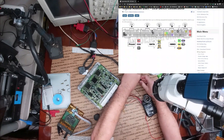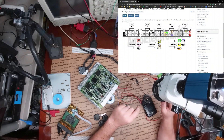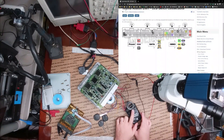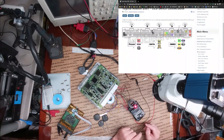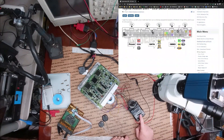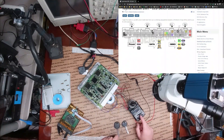These are my main powers here, so I'm going to ground that — I have 14 volts going for this. And here we see our immobilizer lamp blinking, which is normal operation. Now if we put our key in and simulate the key being in the switch, we see there is no change. I'm going to try the second one — no change. And the third one — there is still no change.